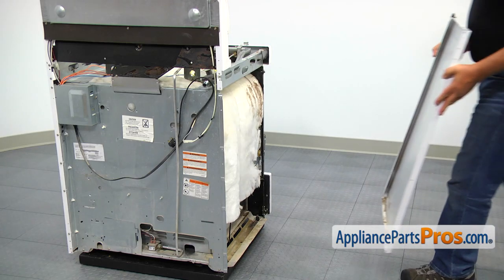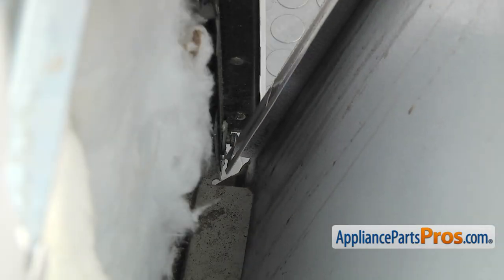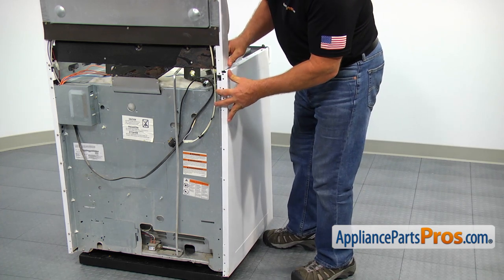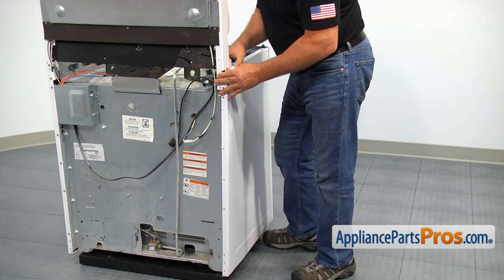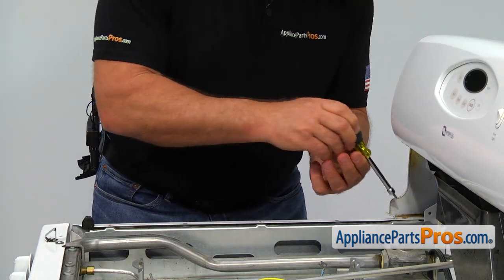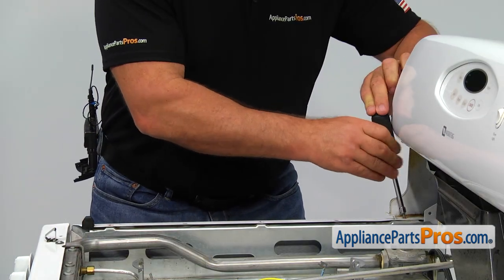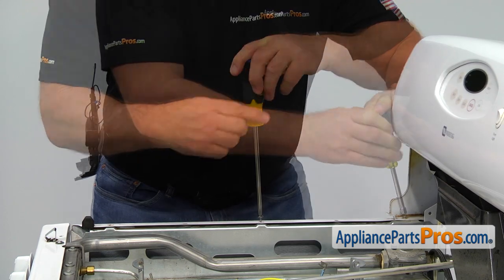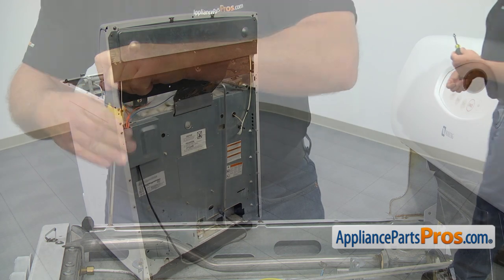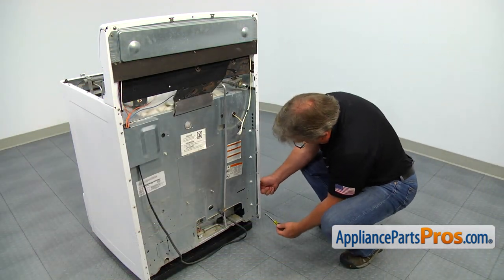Place the side panel on, slide it down to lock on the front pins, and then push the rear end under the control panel bracket. Install the two Phillips and one quarter-inch screws on the top. Secure the panel from the back with seven quarter-inch screws.